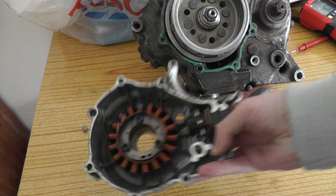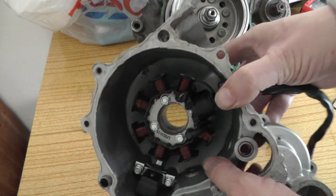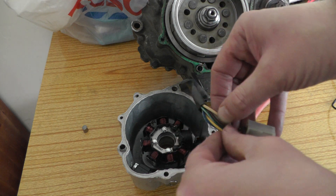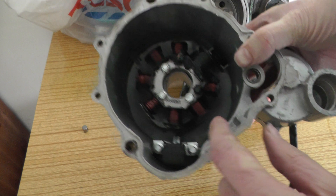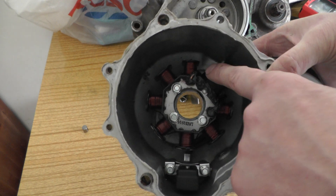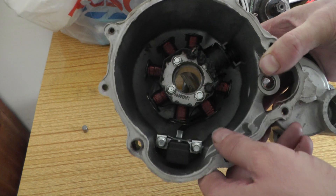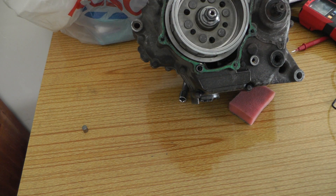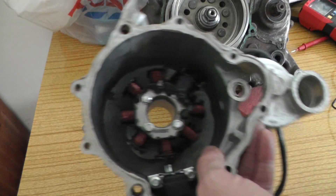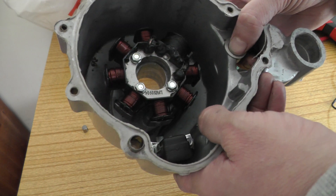This other one here is a two-phase generator — it's only got two wires coming off it, so you test between both yellows. If you look at the cores, they're all similar except for one, and that one generates the power for your spark. On this type of bike, if that coil fails the bike won't start, whereas on the three-phase unit it will still run as long as the pickup coil works — because on the two-phase it needs that dedicated coil to generate electricity for the spark.